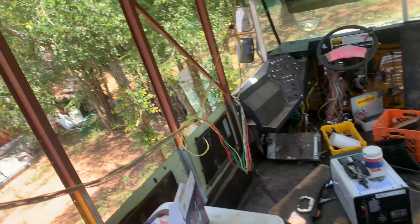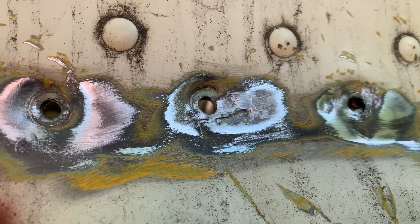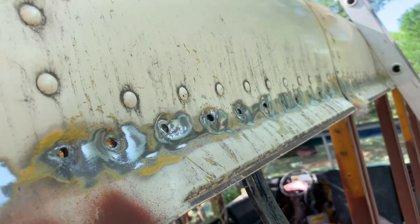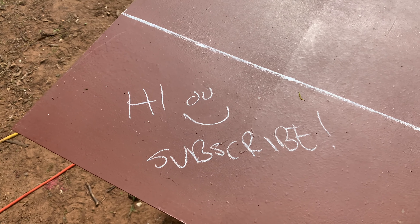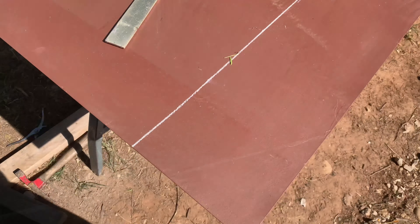After cleaning the outside of the rivet holes, I've gone in with a pry bar and a mallet and pulled the metal out in order to create a gap for where that sheet metal can slide into place. This is an important step because the metal will get dimpled and create little pockets that will stop it. After this we had to cut the sheet metal to size, making sure to cut our lines nice and straight and trim off any excess based upon where the sheet metal needed to overlap.